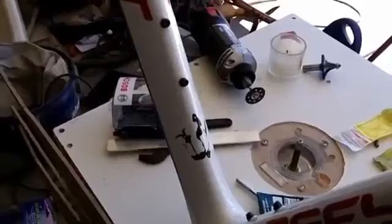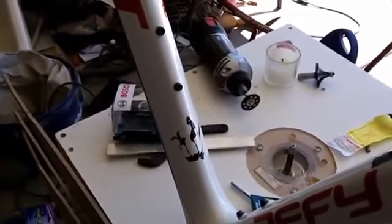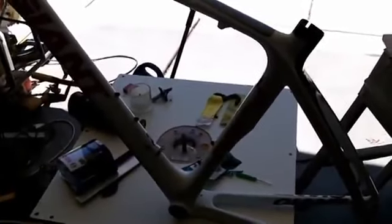Now I'm not a professional carbon fiber frame repairman, so I don't have a lot of the tools that the professionals have, like an endoscope, which you would run down into the tubes and view cracks from the inside. There's also a thermal imaging device that they can use, which ties electrodes to the bike, runs an electrical current through the carbon fiber — which is conductive — and any crack heats up and they view that on a thermal imager.